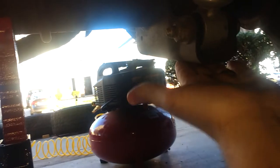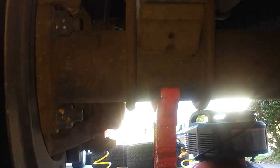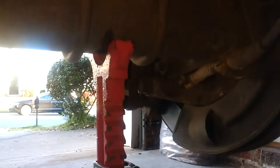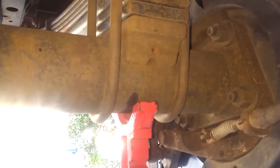On the back side it's pretty easy. I put a jack right here under my shock, and then put my jack stand right here between my leaf springs — nice and firm connection. Same thing on this side: put it up right here underneath my shocks, and got my jack directly under my leaf springs. That's going to make it very sturdy.